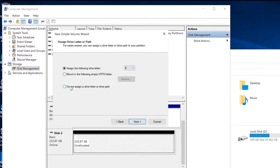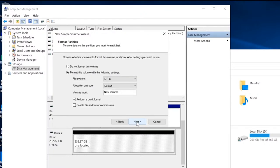And there are other things you can do, but right now we're just installing this drive so that we can use it. If you are interested in a lot of other IT stuff or computer related stuff that goes into detail about this, you can certainly go through my channel. I have a lot of videos like that. Then we're going to click next and I'm going to format it. I'm going to leave it NTFS, because it's internal.